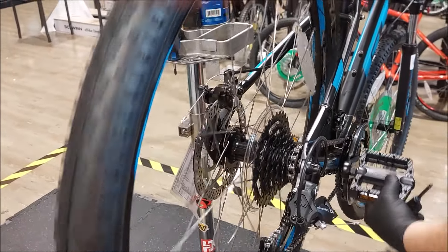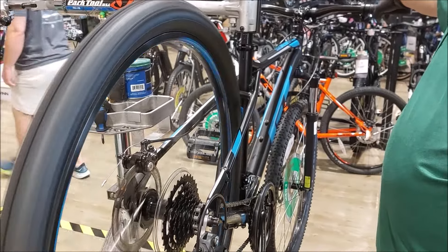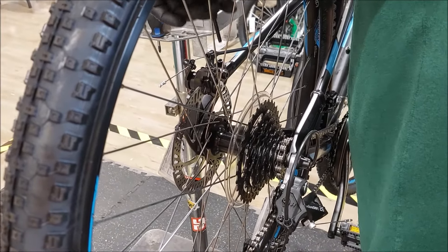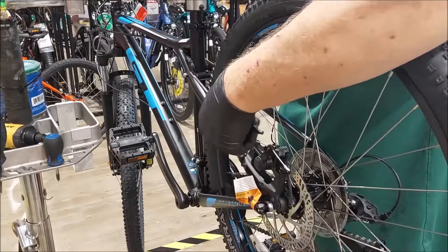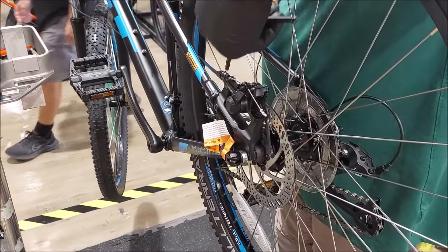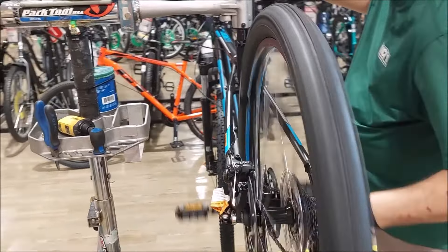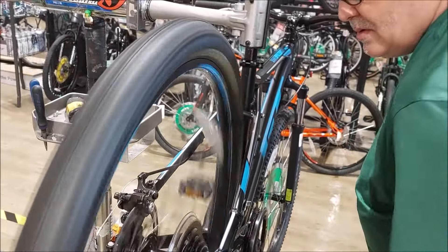It's completely loose now — let it run, self-centering, trying to get the wobble out, and I'm going to brake. You can see the caliper move. I want to retain the caliper in that position by gently tightening down the nuts until they're basically mated up with the mounting bracket — snug. When I crank it down tight I alternate top and bottom. Still a little bit there... that's gone.